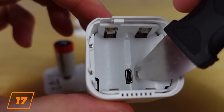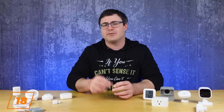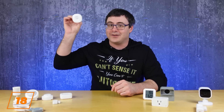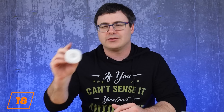It can help to have an option to plug in your sensor, as this can remove restrictions on how often a sensor can report back to the hub. This would mean a Wi-Fi plug-in sensor could be as good as a battery sensor of another type. Many sensors today have pretty specific mounting requirements, and this is especially true with motion sensors that often say they have to be around seven feet or higher in order to properly catch motion. So check out mounting requirements and follow them religiously, or it just might not work right.